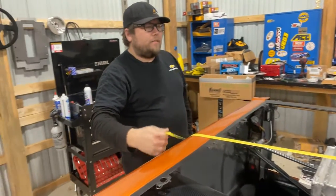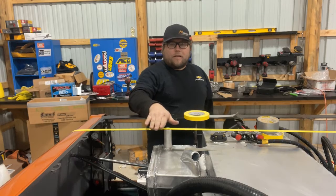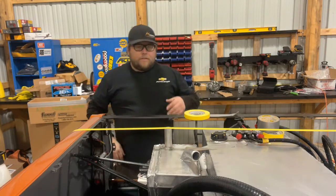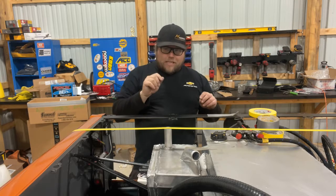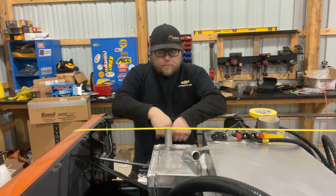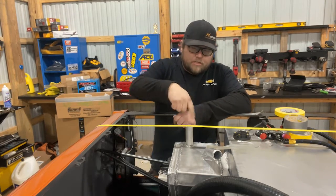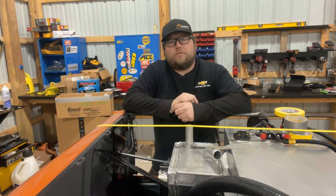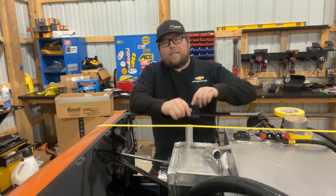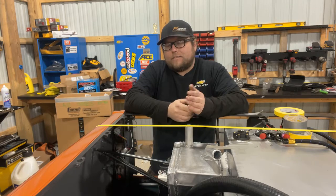Pulling this piece of tape, you can see the little hump up and back down where the chimney is actually sticking slightly above the surface — that's exactly what we want. We're looking for the chimney to stick up out of the bed slightly. Before final installation, we'll tape it up and paint it black. The bracket is now taped in place. Taking this back to the shop to weld the top on, paint the chimney black, and then fit the bed cover. You don't want to mount it while still fitting the bracket, because then you'd end up with a misaligned hole in a carbon bed cover.